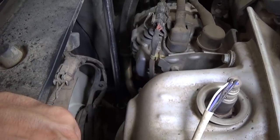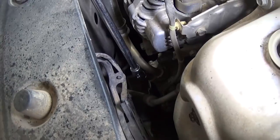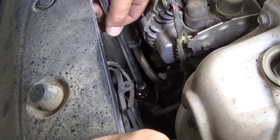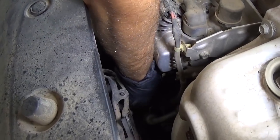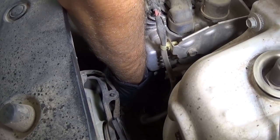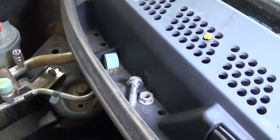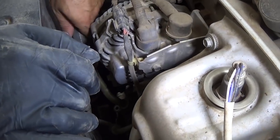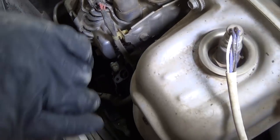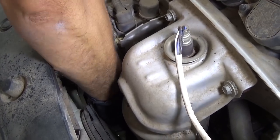Now there is one more right there — that's for the low pressure side. It's a little bit inconvenient but you can get it. This one looks like a bolt right there. Go ahead and remove the hose. You still have some pressure — just a little bit, not much — but imagine if you didn't take all the refrigerant out, it was going to spray refrigerant everywhere.